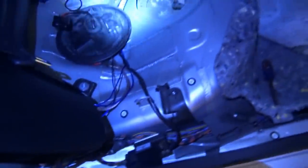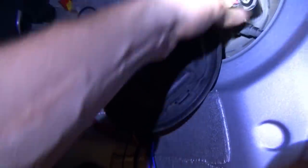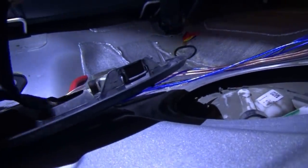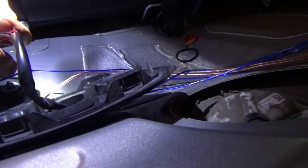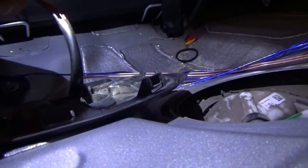Here's the fuel pump control module - it was just kind of hanging out. And our fuel pump connector is unplugged. That would definitely explain our problem with the fuel gauge and the fuel pump not turning on. I have no idea why this is unplugged. Has anyone been back here? Apparently yes - he was doing some checks and said he was going to plug everything back in. He just overlooked that one. Well, this one's kind of important.